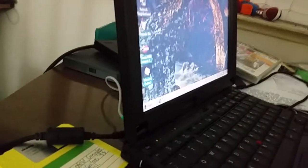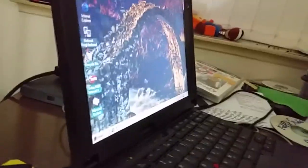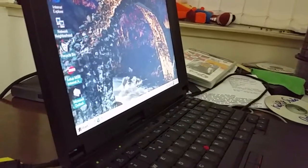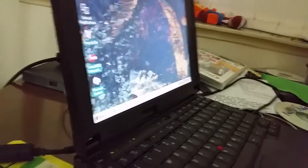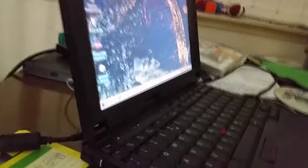After the 2350, Dell actually went to use solid state capacitors on the boards, which will help the longevity of the machines. Did the 2400 have solid caps? I don't know. On the 2350, you'll just have to replace them after a while, but that's not too bad. I got Billy a replacement motherboard for his 2350 because the motherboard went. Should have bought him a 4600 motherboard instead because it has an AGP slot.